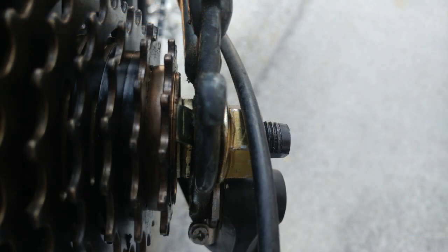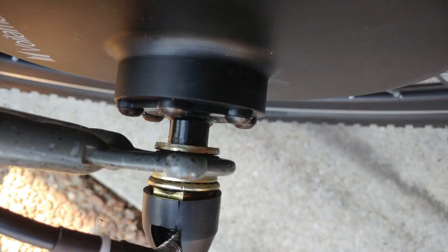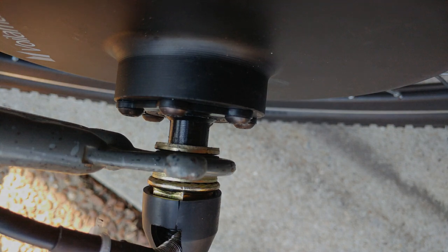When you put the wheel on, make sure you've got enough washers between the sprocket cassette and the frame so that your smallest ring has plenty of room and doesn't rub against the frame. Also make sure the wires coming out of the hub are going up instead of down, assuming you want to run the wires up along the frame towards the seat.